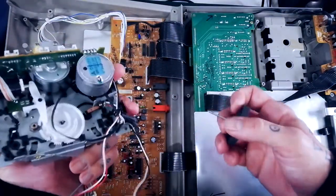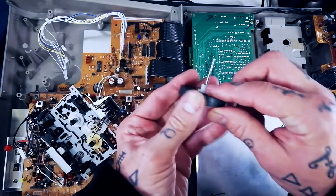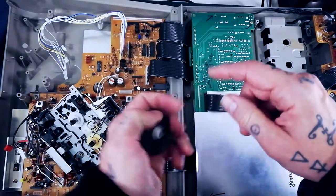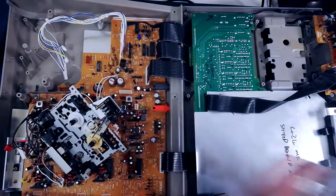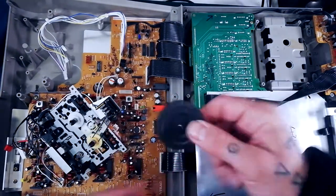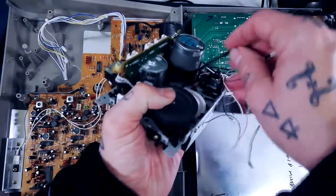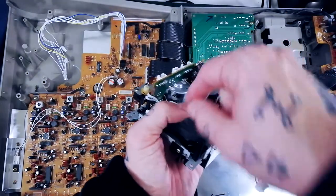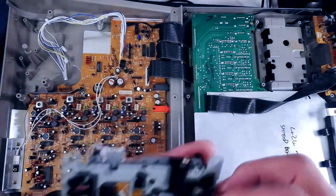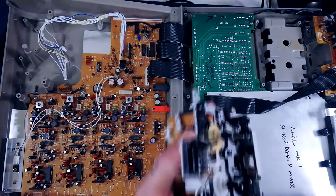The flywheel is falling out — there's a little recess there. Depending on the design, you'll either have a plastic clip or an E-clip there. If you've lost the clip, you can get a component box with eight to ten different sizes of E-clip, which will almost certainly include the correct size to hold it on. It looks like a very easy belt change — you wouldn't need to remove a plate or any screws. Just hook the belt around that pulley, then over the flywheel. There's also one shorter belt for the counter mechanism. With this kind of pinch roller, you can just put a flat-head screwdriver in and pop it out, then slot in your replacement.